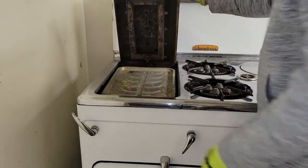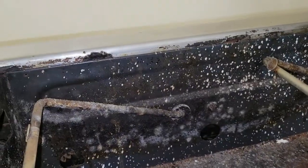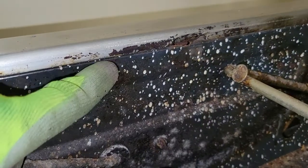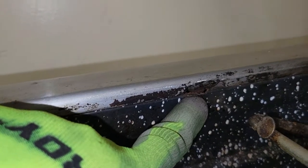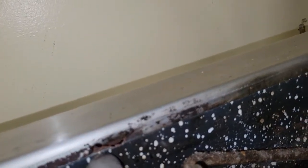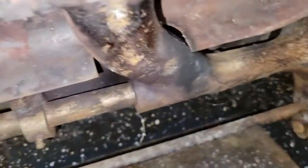Hey, it works — needs only a little encouragement to come up. It's got the broiling pan and the drip pan. Now here's something important: when you examine the broiler, you want to look along this seam all the way around. This is a great place for moisture to catch. You see right there — that is a screw having rusted through the screw hole. That's going to require repair to make sure the broiler stays where it should. That's not unusual at all. You don't have to replace the broiler — you can fix a bracket in there so you can use the original screw.